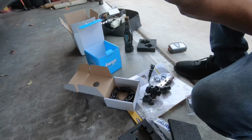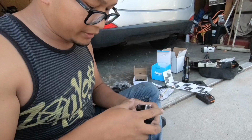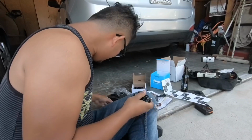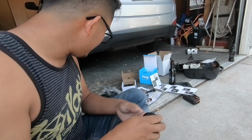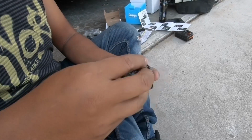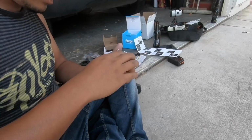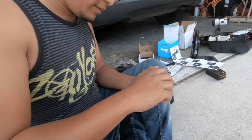Repeat that for the people, Lee. So this diverter valve kit comes with two springs. The yellow one's already in there. Supposedly the yellow one is supposed to push between 15 to 23 pounds of PSI. Since my car is a Stage 2 tune, I'm running between 25 to 30, so I'm going to use the blue one instead. The yellow one's in there, so you guys can see. Just basically take it out and just put the blue one in there. Nice. There you go. Perfect. There it is, guys. For the guys between 25 and 30 pounds right here, remember, blue spring. She's all ready for 30 pounds of boost.